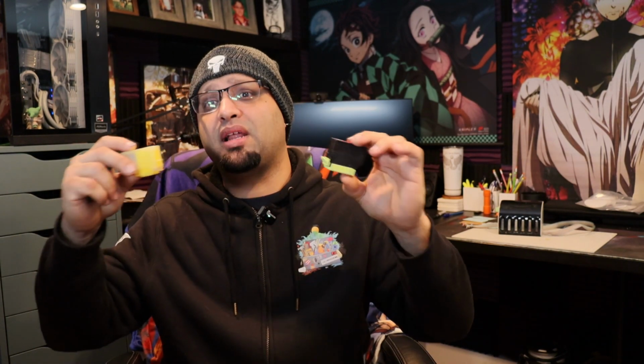Again, you're continuously feeding ink into it, so no matter your level, you're going to be fine. You're not going to run out of ink as long as your tanks are fine. But I don't like to have them completely full, because if I'm taking a quick break and not printing for an hour or two, I don't want to be afraid that ink might fall into the print head because I have too much ink in here. So again, half is good. Fill them up and don't fully purge them. Always leave a little bit of air in them. Then when you start printing, that bubble will come in here and you'll see that level come down, and then you'll be perfect. That's what I do. It has always worked for me.